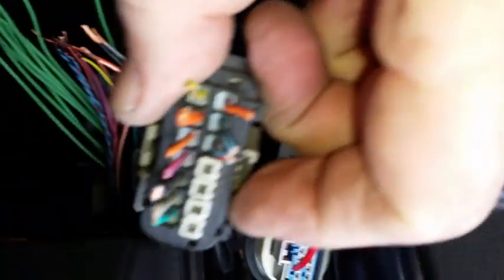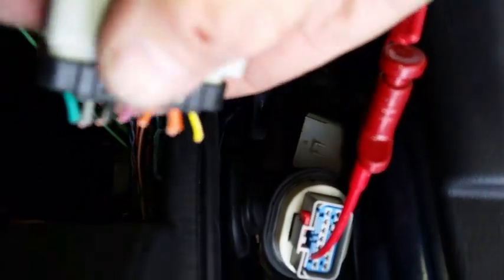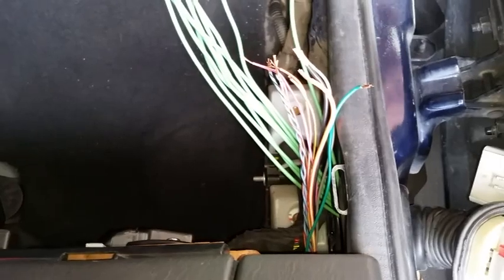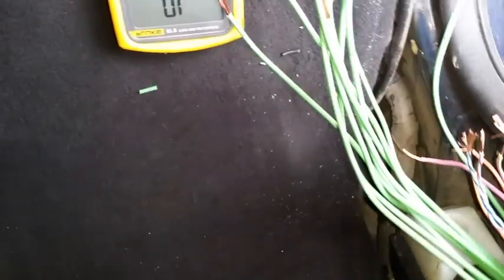Okay, so that probe is engaged, if you look, in such a way that it's touching that second down terminal, which again, in the beginning, we reliably put a green wire in every one of these positions, not those four, but the other 10. So, turning it around, with the red pointing down on the left, the power wire was second down on the left this way, but it's on the right this side, but it's on the left this side, which is where that thing's connected. So it's just a matter of taking the other lead of the multimeter and touching which green wire is that terminal, because you don't have the color codes anymore on this side.